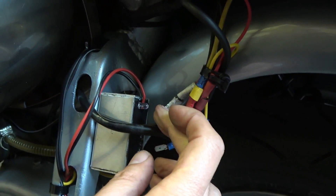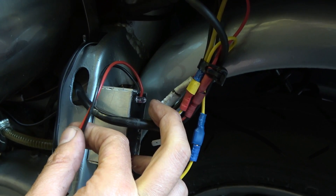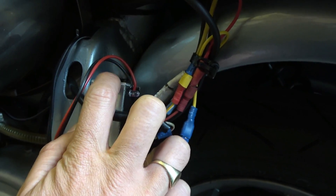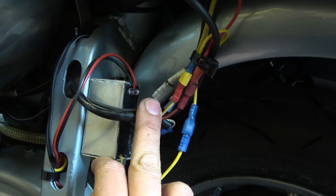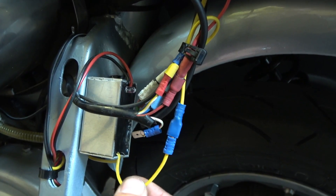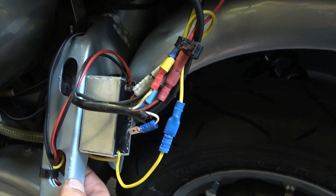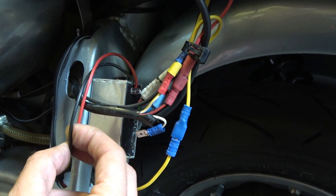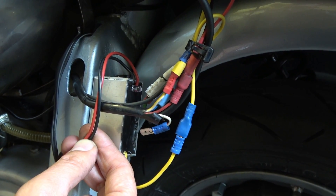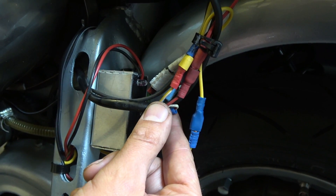Obviously the main idea of the IntelliConverter is not just to run a SIP Speedo, but you can use this 12-volt output to power any low-powered device, like charging a phone or running a sat nav. He's about to make an upgraded version of the IntelliConverter which features two USB sockets, so you'll be able to charge straight from this unit. Basically take an AC feed from your lights output straight into it, the other yellow wire to earth, and you've got a clean DC — even when there's less than 12 volts coming in, it puts out a very steady 12 volts, which is more capable than the primitive mod charger that a lot of people use, which only works when the engine's running at high revs.